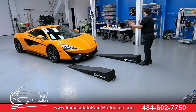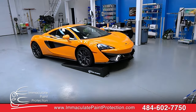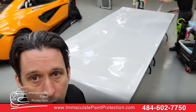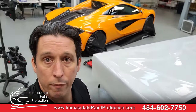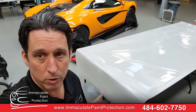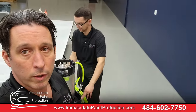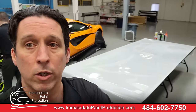PPF time. We've got the PPF by the car — the car's up on the race ramps. Dan's spraying the PPF down to get it off the release liner. We're gonna start off at the back and do this piece right here. If we need to adjust the slip solution, we'll adjust it. The slip solution is distilled water and baby shampoo — it makes it slippery so the adhesive doesn't bite to the car right away. Let's get going.